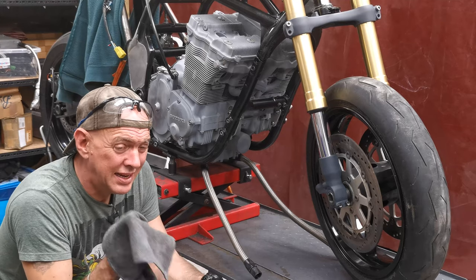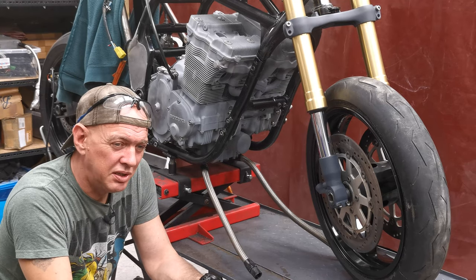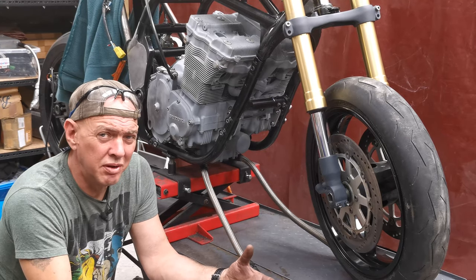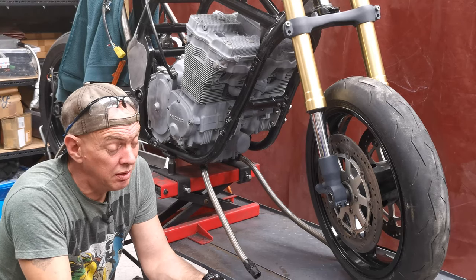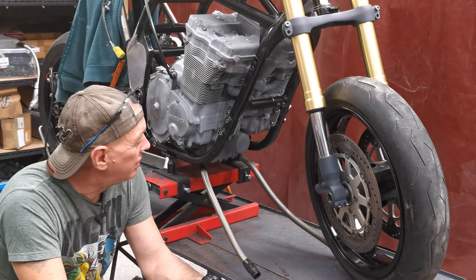The other thing I'm hoping to get back is the shock off Simon Rolls. I'm hoping he's been able to fix it. I did have another message from him. He reckons it's all to do with gassing because all the mechanics of the shock look absolutely fine. There's no wear or anything else. So it could either be there ain't no gas in it, which we know there weren't, or it could be the bladder that the gas goes into is buggered, in which case we need another one.